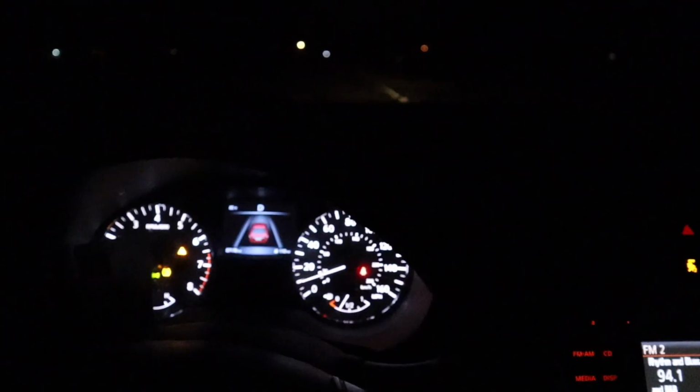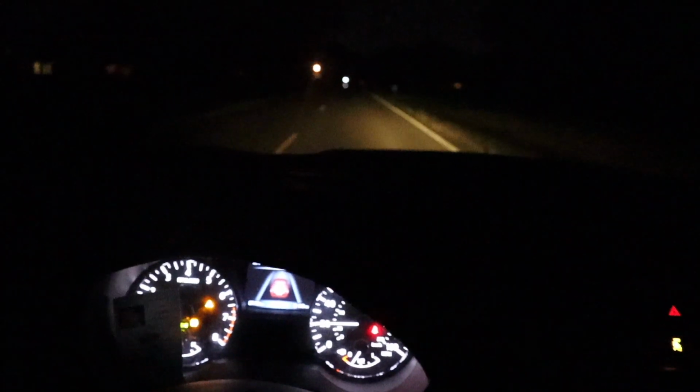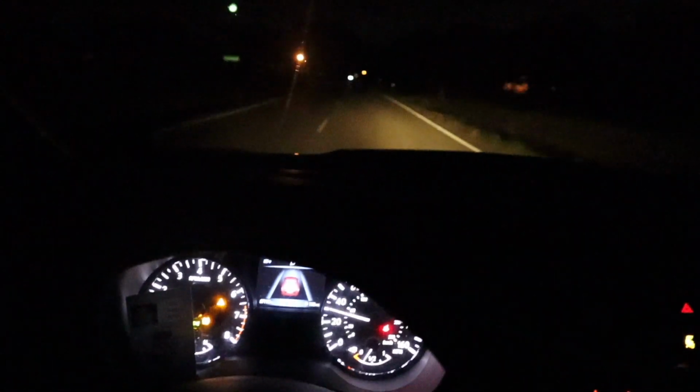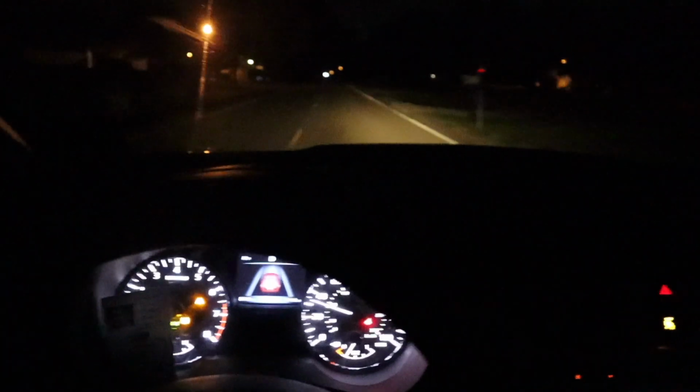In this video, I'm gonna be showing you the difference in LED versus halogen. What I did was I installed some LED lights in a 2016 Nissan Altima, and the car already had the regular halogen lights that you get with the Altima. And the big difference on this car is it's a common problem with these Altimas. I'm finding that you got a headlight that's gonna either be real unlevel, or you're gonna have one that's cracked and you get water inside of it.